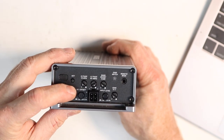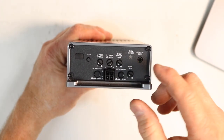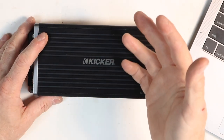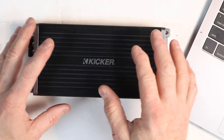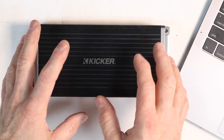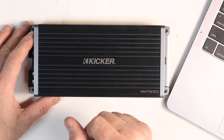The last thing on this end is the gain match LED, which lets you set the amplifier for maximum gain. There's a whole setup process we'll walk through. With any sub amplifier, it will not fix ANC — active noise canceling — or fake engine growl. That has to be bypassed separately for any sub amp to work properly. If you're not sure whether you have it: finish the install, rev the engine, and if your subwoofer growls louder you have some form of fake noise in the car.